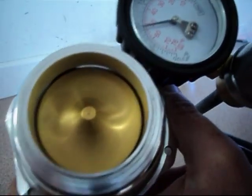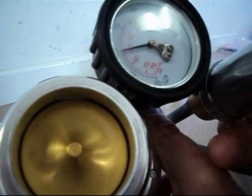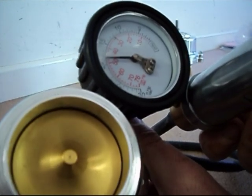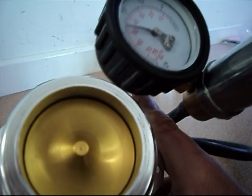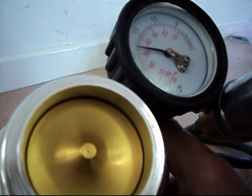So you can see that this valve is at about twenty inches of mercury before it starts to open, and at about nineteen it's closed again. That's nearly four times greater than where it should be, and this is quite detrimental to the reliability and health of the superchargers.